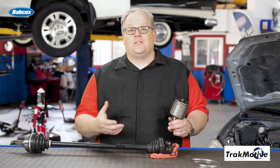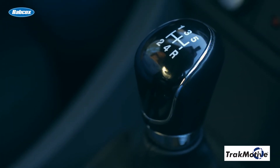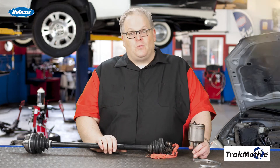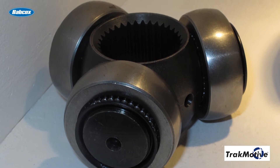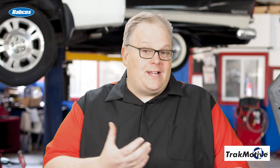This play will eventually cause noise that the driver will notice. It could be a clunk when they go from gear to gear, but it's going to fail eventually. So it's critical if you run into this condition where the tripod joint has been pulled out of the axle or the plunge joint, you need to make sure that you're servicing it properly and even replacing the entire axle, because you cannot predict what has gotten into this.